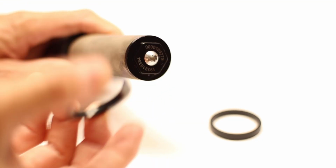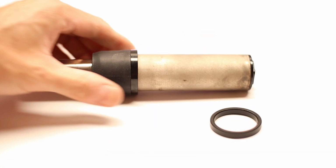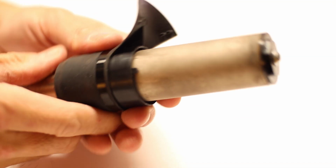So now with the Future Shock cartridge removed, you can weigh your options and decide on what combination of duckbills and proprietary headset spacers you want to use. And just make sure that they all go between the rubber boot on the Future Shock and your duckbill of choice. Just to clarify, once you reinstall a Future Shock, you can't add or remove spacers to change the stem height without removing the whole thing again.